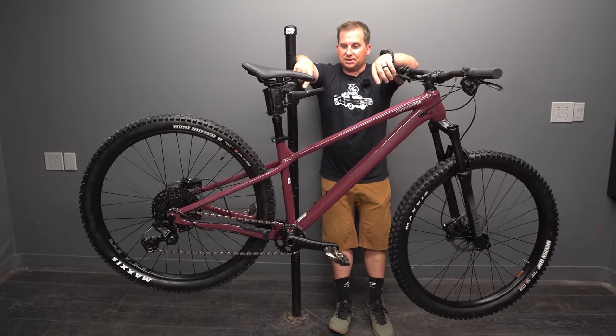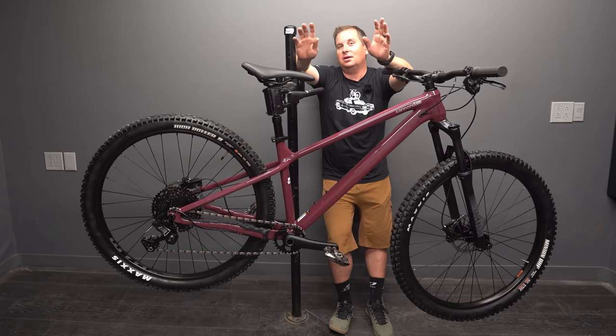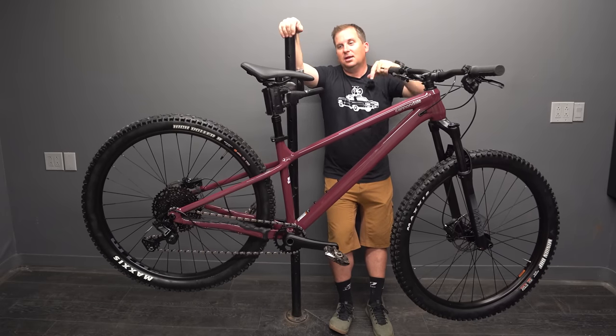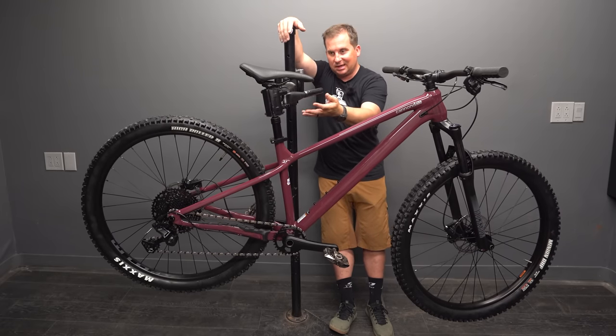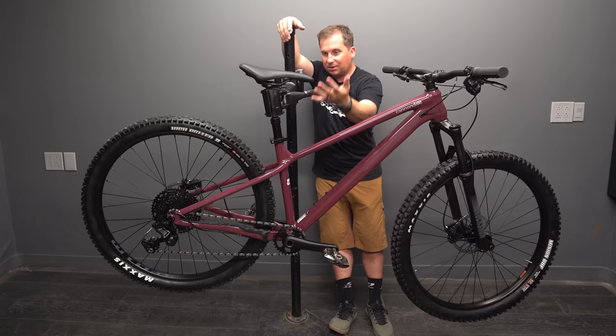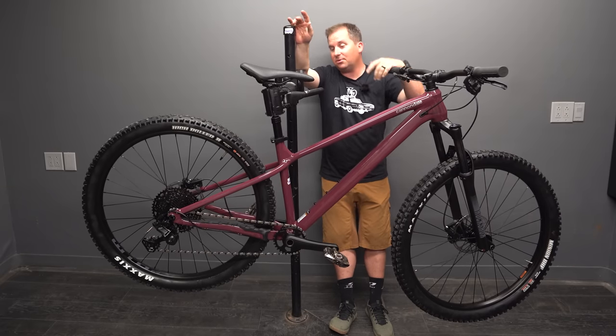I could probably run a 175 on this with how long it is, but even the large and extra larges are only running a 130 dropper, which is a bummer, because that means when you buy it, you're paying for a dropper, but it's not a very desirable dropper because it doesn't get out of the way that much. Now, some people are fine with 120 and 130 mil droppers.